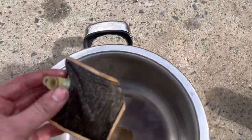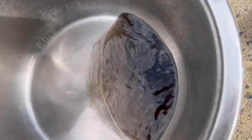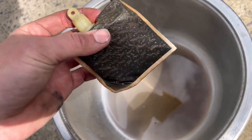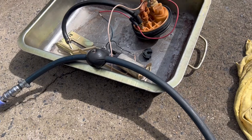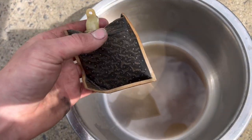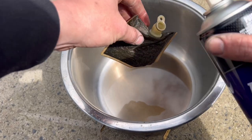I've got the fuel pump out and I've pulled off the filters on the bottom of the pump, giving it a bit of a clean up with some carby cleaner. Look how brown that is - I'm assuming it's going to be dirty fuel, so we're going to drain it. Like I said: drain the tank, new filter, clean this up. I'll also need to wire in a relay for this thing because it's got no relay, which isn't too bad. Thanks to Elijah who's always helped me out and given me tips on how to do stuff.